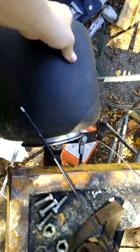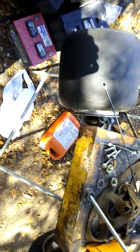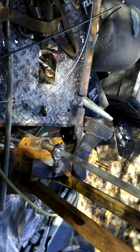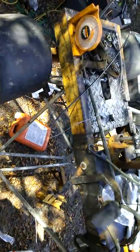Front tires are flat, as you can see. They also have the go-kart rims up front. Go-kart hubs, I mean. It's got go-kart spindles and go-kart hangers, and it's got grade 8 bolts in the front. 5/8 rod running down with 2 heim joints, left-handed thread heim joints, down to a 1/4-inch piece of flat stock that I had. Got the front tie rod basically welded up.